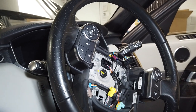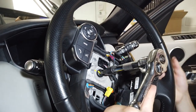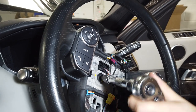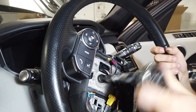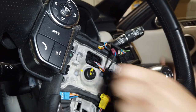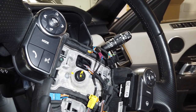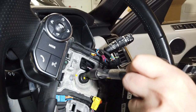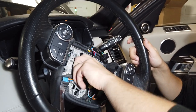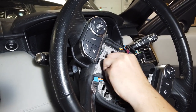We've got a Torx T50 bit and we're going to undo the steering wheel. We've got the steering lock clicked in so that'll resist some of the force. There you go — that wasn't too bad. Now, this is on a hexagonal spline — the older steering wheels had them on a load of splines and you had to be careful to get it on the right way. You need to look at what angle your steering wheel's at because you need to put it back on that way.